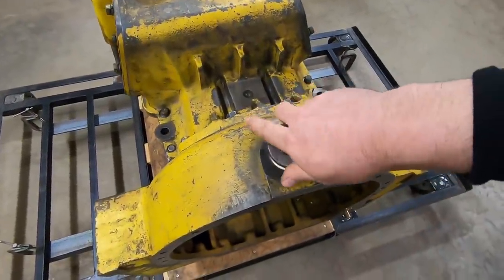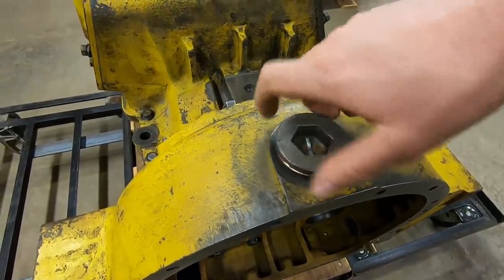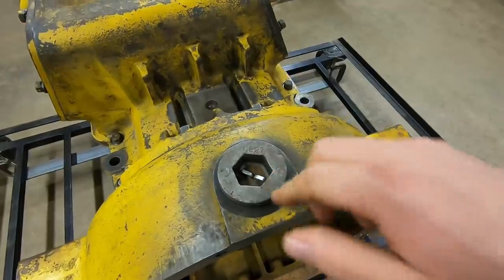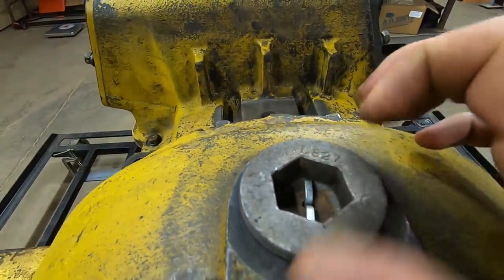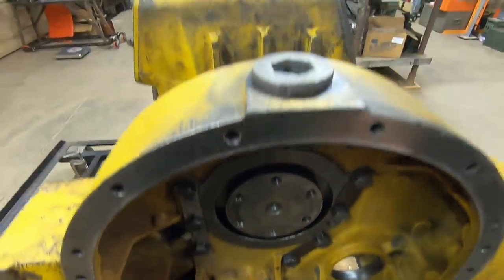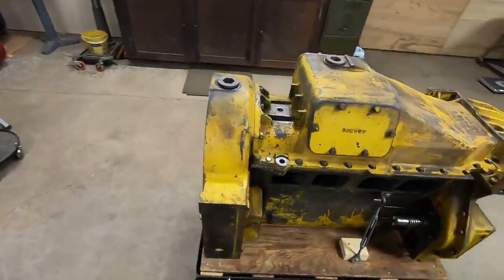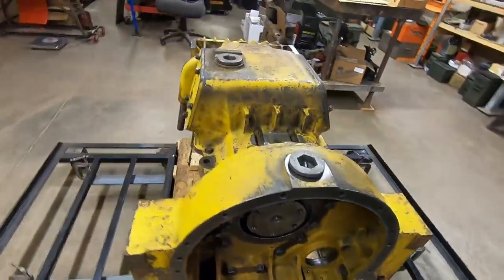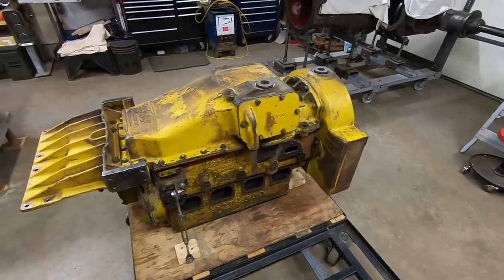Get that started - first try, there we go - and tighten that in. Note: if you're going to operate in deep water or deep mud up to the bell housing surface, you'd want a solid plug so water and mud cannot get inside. But I don't think we're going to be doing much off-roading with old 1113. That made it look a lot bigger - wasn't too bad of an installation, nothing gave any problems at all. Next episode we're going to give it the big flip, get it right side up, get that new stand on there, and then the next phase begins - starting to assemble the top end. Going to be a couple days before we attempt that while the paint dries.